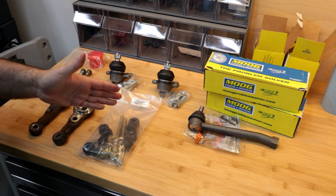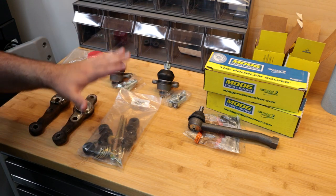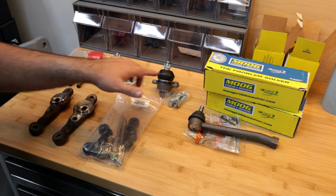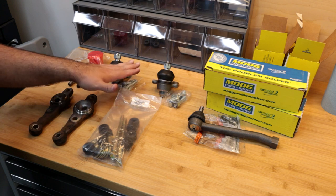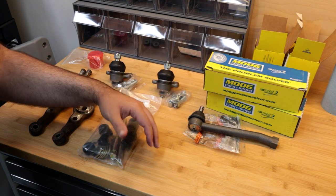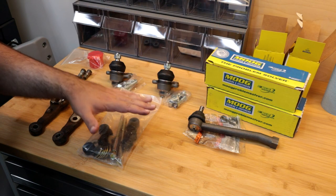So I got lucky there because I didn't order anything. I didn't even think about that when I was doing this job. So I got brand new end links with energy suspension bushings, and I went with Moog parts. The ball joints are gonna be the same for side to side, so that's just one part. But if you're gonna order tie rod ends, make sure you get the left and right. There are two different part numbers for that. I'll put links and part numbers and stuff down in the description.